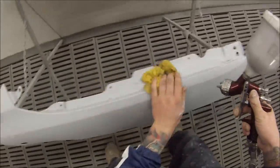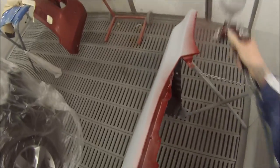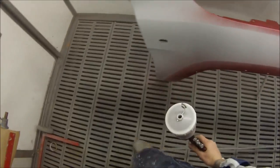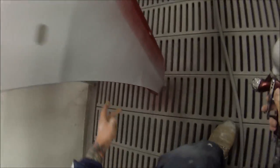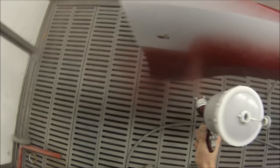It's pretty important that you keep wiping until it's completely dry, because if you don't you can be left with a slight film in between the panel and your fresh paint, and it can actually lead to delamination and stuff like that. So I usually go over them a couple of times. Next up we're starting to tack rag it — that's a yellow rag, not a standard tack rag; it's got a bit of stick to it. You've got blue ones and yellow ones. The yellow ones are a higher tack; I prefer the yellow ones personally because they've got more stick and are more likely to pick up more bits of dust, whereas the blue ones are more designed for base coat, so they're a low tack.